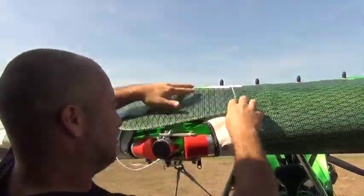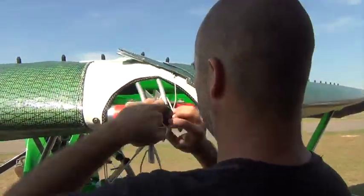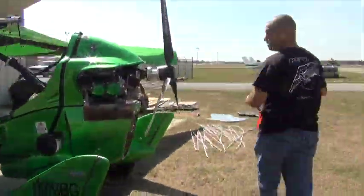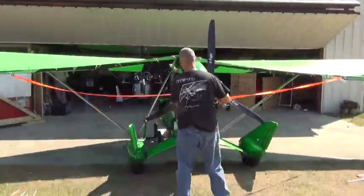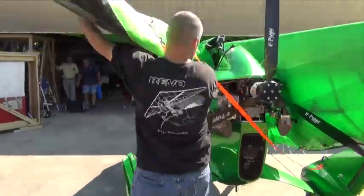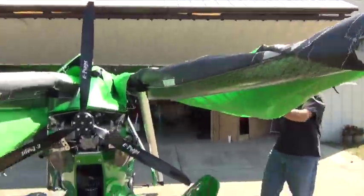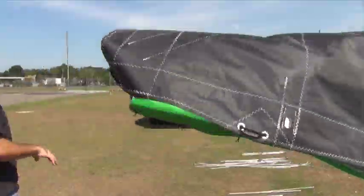Don't forget to remove your nose cone — you don't want to hurt it. We can go ahead and stow the nose battens back onto the wing. Hook up a strap and go about mid-span, then run the two straps together. These are a little bit short, so longer straps would be easier, but pull them and catch them. Flip the fabric to the outside and do the same for the other side. Be very careful with the propeller — don't do it with a hot engine, make sure your exhaust is cool. Pull the fabric to the outside and now you've got the wing folded.